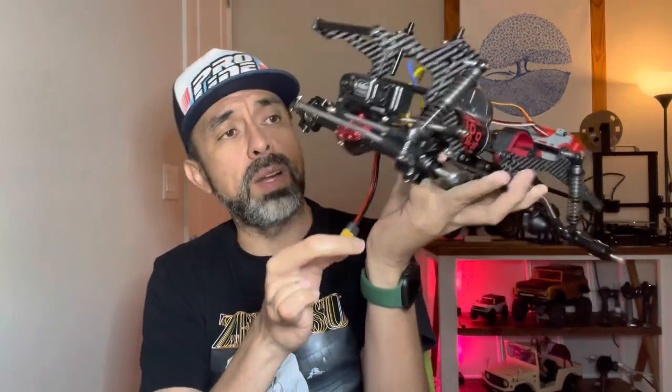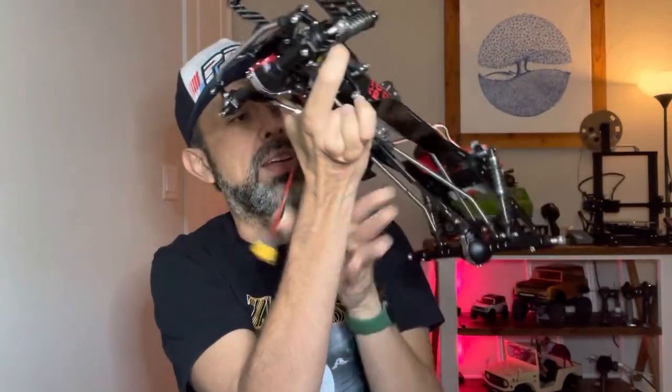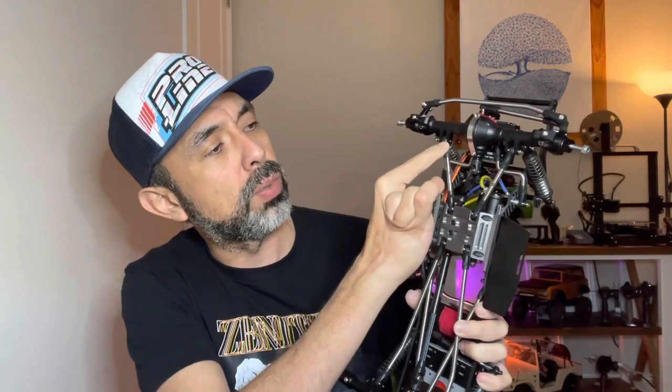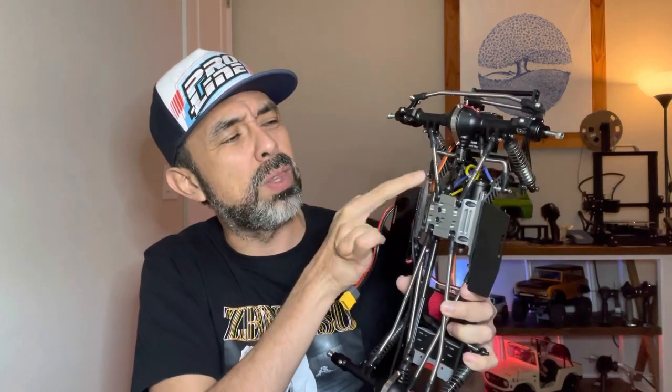You can change them. Actually, I think this is what I'm gonna do. I'm gonna change these links, and I will use this location instead of this one. And I'm gonna get some shorter links in order to get better articulation. And I think if you do that, you don't have to change these bent links.